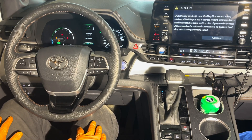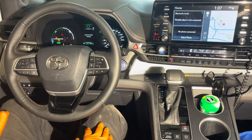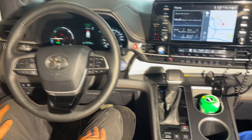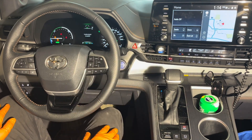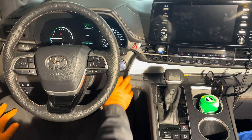We've got it back in maintenance mode again — just give it some revs, let it rev up for a bit, then idle down, rev up, idle down. Do that until you're getting nice hot air blowing out of the vents and that tells you you're done. I've had it running for about 20 minutes and done the bleeding procedure three times with shutting it off, putting it back in maintenance mode, and revving it up and down — now it's blowing nice hot air, so we're going to shut the engine off.